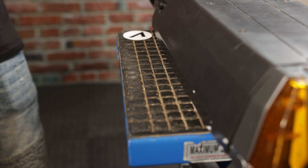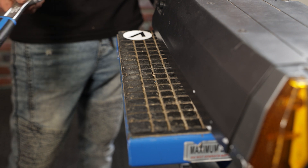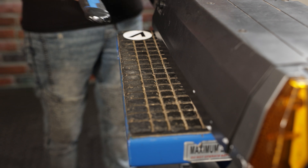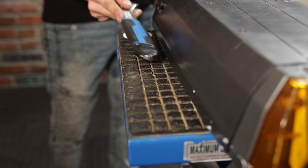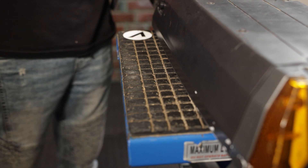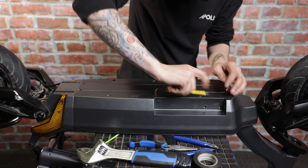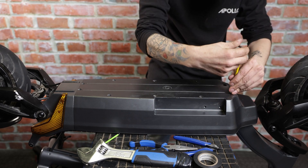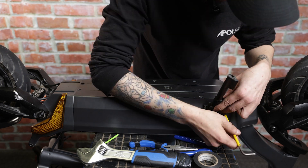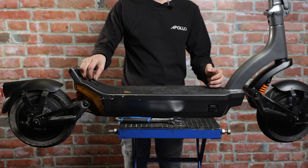You got your deck cover back on, but if it's not lining up, this is a simple fix. Take either a rubber mallet or something with rubber ends — or wrap something with electrical tape — and give it a little love tap. Everything will go right back into place. After that, commence tightening the screws all the way. Torque down your screws as much as you can by hand without over-tightening, as we don't want to crack the plastic. Now go ahead and reinstall the kickstand. And that's how you replace the fender assembly on a Citi 2022-2023.